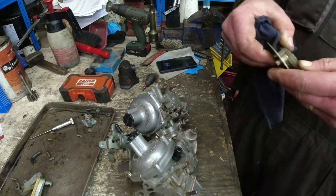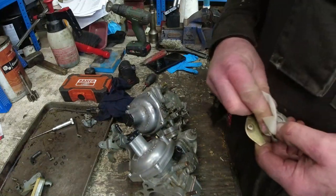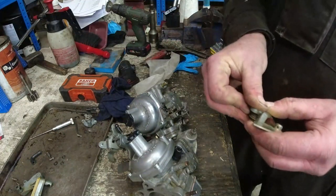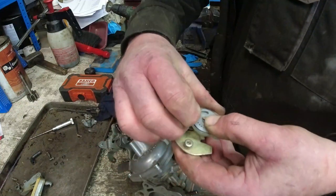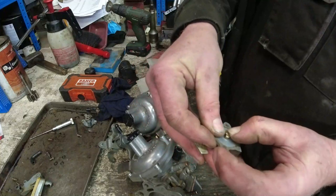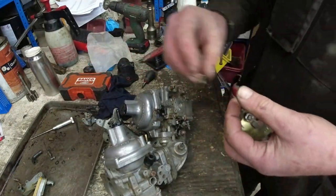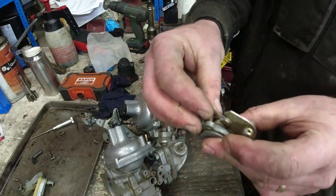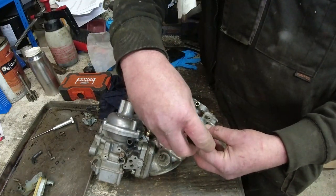I'm struggling to get that stuff off there — let me get a little wipe. There it goes. Now you could put a bit of Hylomar around here, but don't generally find it needed. There's still lumps of this stuff balling up — if it's balling up it might compress, or it might not. But if you're going to get air coming in here it's not going to help, so let me clean this up properly. Each of the screws that hold these down is a recessed countersunk screw with a countersunk washer that just needs to sit into the threaded hole — fairly easy.